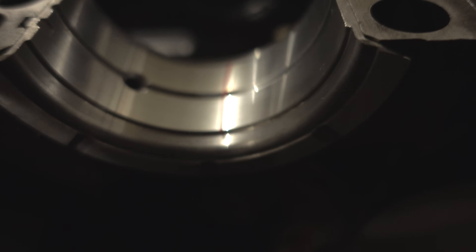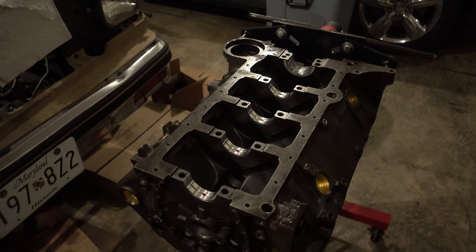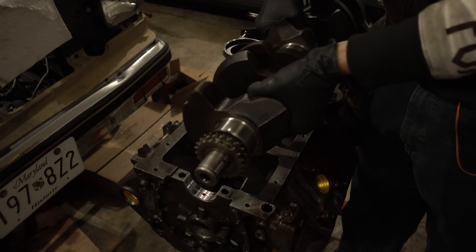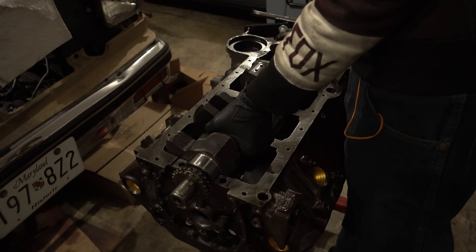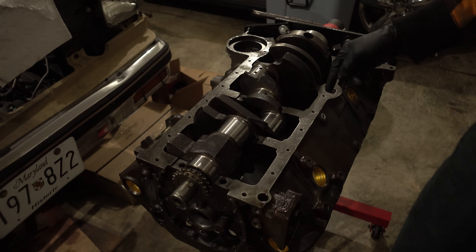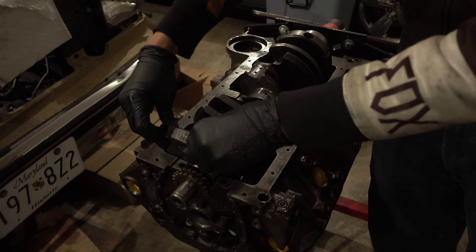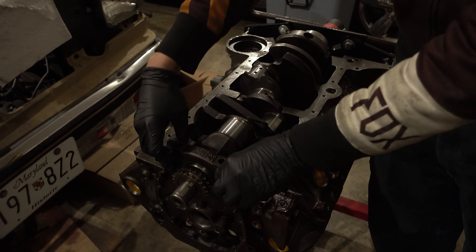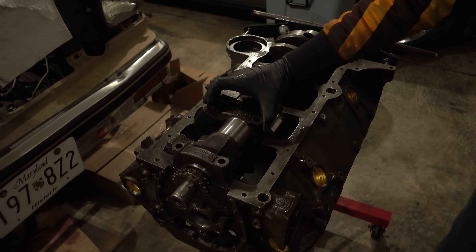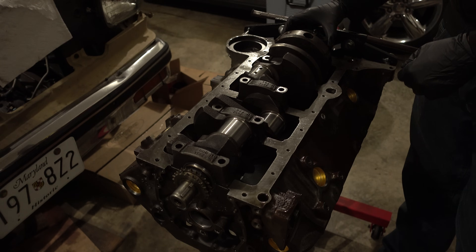Now that that's in place, we'll grab the crankshaft and drop it in. I just gave the crankshaft one final wipe-down. Drop it in straight, slow, easy. It's important not to rotate the crank because it'll wipe that plastigage off and screw up your readings something fierce. We'll set all our caps in place, making sure to adhere to the direction and the order, and again there's no oil on any of these parts for this step. Make sure these all seat.